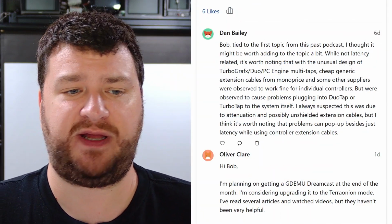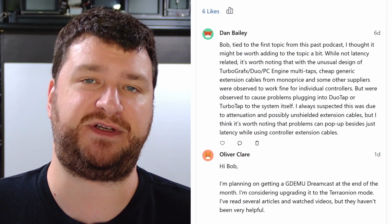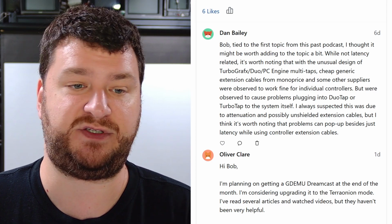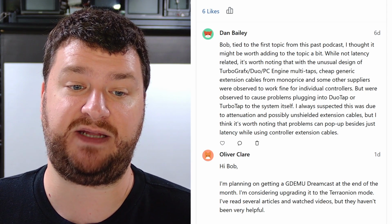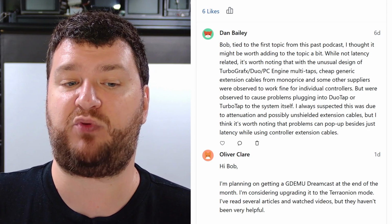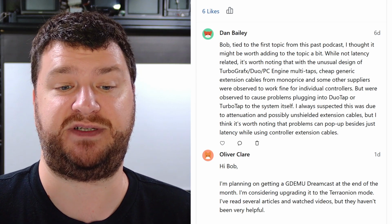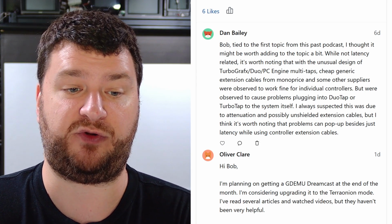First up, over on Patreon, Dan Bailey wanted to chime in on the whole extension cord, adding latency, what other things you could see from it conversation. And they said, while not latency related, it's worth noting that with the unusual design of the TurboGrafx Duo PC Engine multi-taps, cheap generic extension cables from Monoprice and some other suppliers seem to work fine for individual controllers, but were having problems when plugged into the Duo Tap or Turbo Tap to the system itself. They always suspected this was due to attenuation and possibly unshielded extension cables, but they think it's worth noting that problems can pop up besides just latency when using controller extension cables.